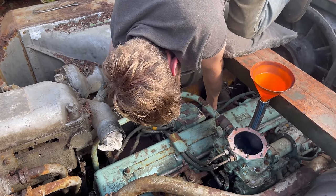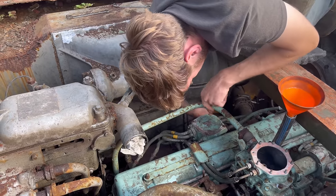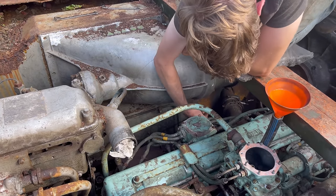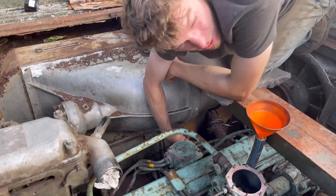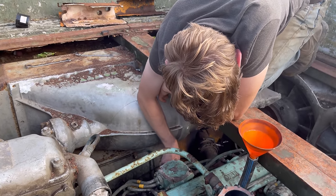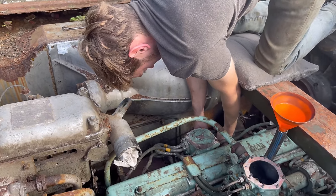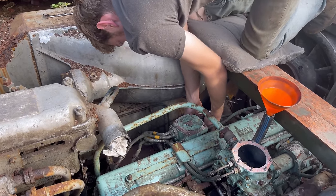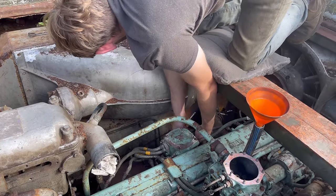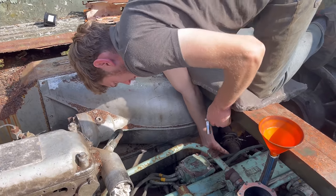So I'm trying to get it. The exhaust valves were just stuck. I took the rocker cover off. I can't remember if I filmed or not. And the inlet valves are all okay. They're not sticking. They're going up and down. So it can only be the exhaust valves, which are, funnily enough, under the exhaust in a horrendous place to get at. So I've got to take off the asbestos covers,